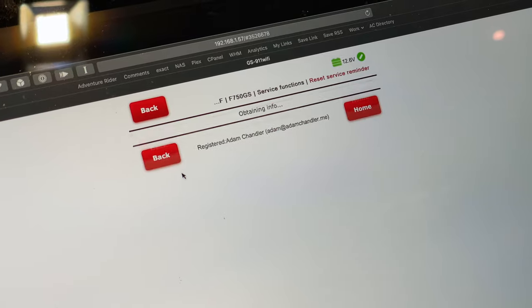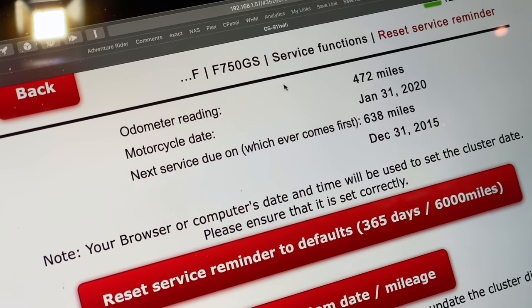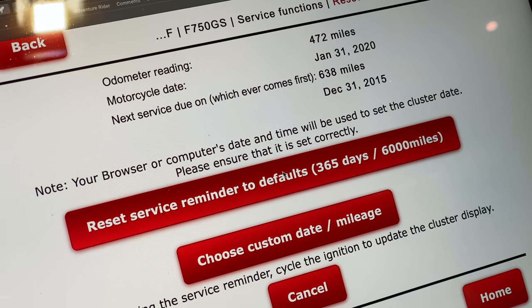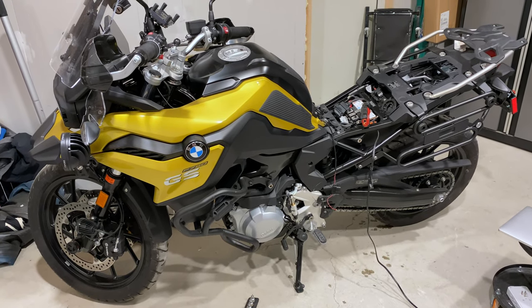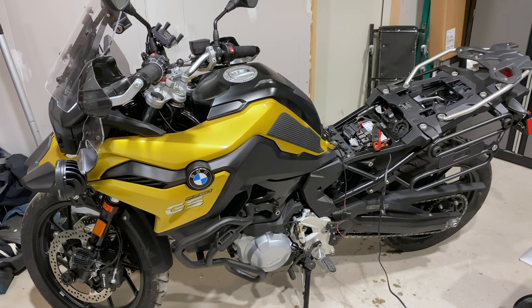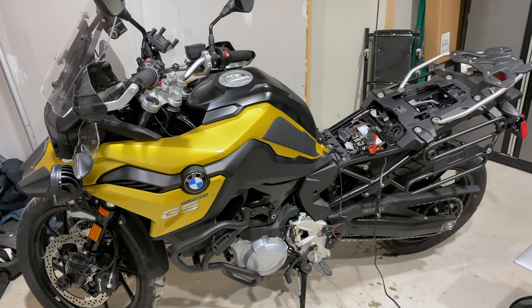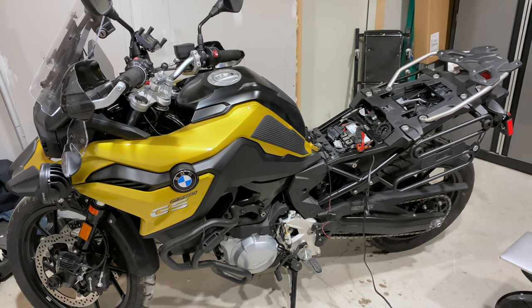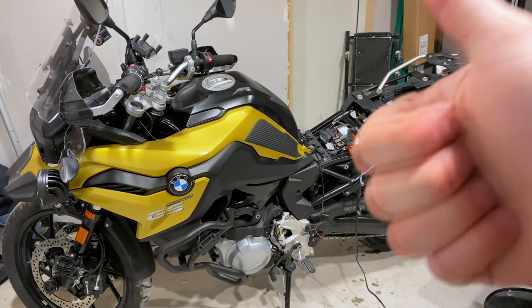Reset service reminder. The service was due at 638 — it's actually at 472. I hate servicing bikes literally a week after winter ends. So we're going to reset the service reminder to 6,000 miles. Boom — very done. Thank you for watching. Heather didn't do a lot this time, but at the 6,000 mile service — which is still just an oil change and a few other checks — she's going to be doing that. And then at 12,000 miles is the valve check. I'm not quite sure yet if we're going to take it into the BMW dealer for that. But oil changes are super easy on this bike — air filter is a little bit harder to get to, oil filter was easy. Just do your checks, make sure things are looking good. It's a brand new bike, no cause for alarm. The oil looked really nice. Thanks for watching. Ride safe and take care.